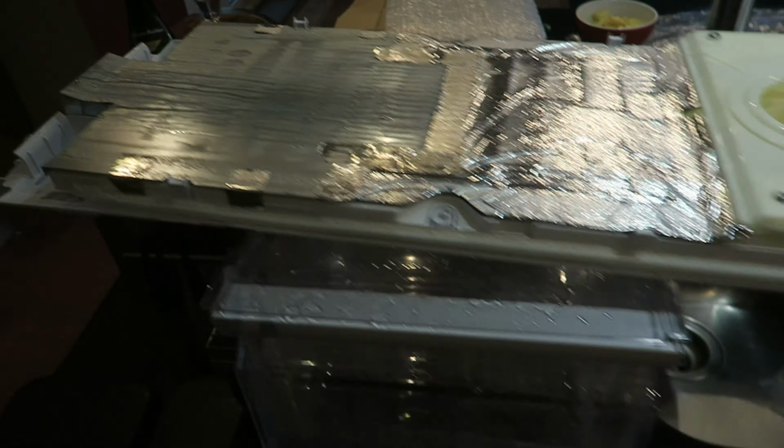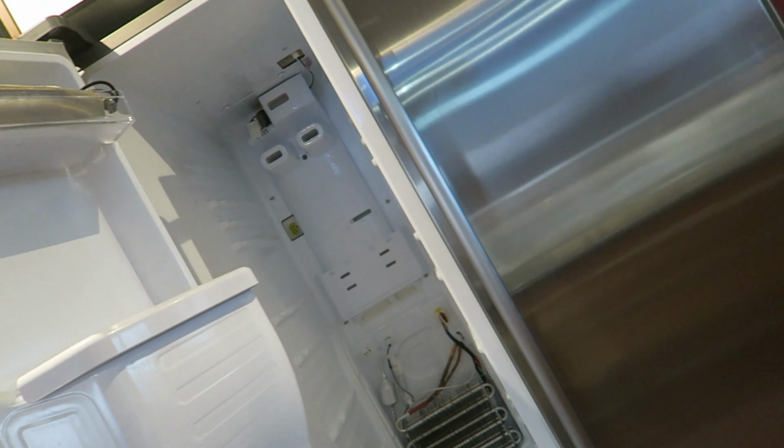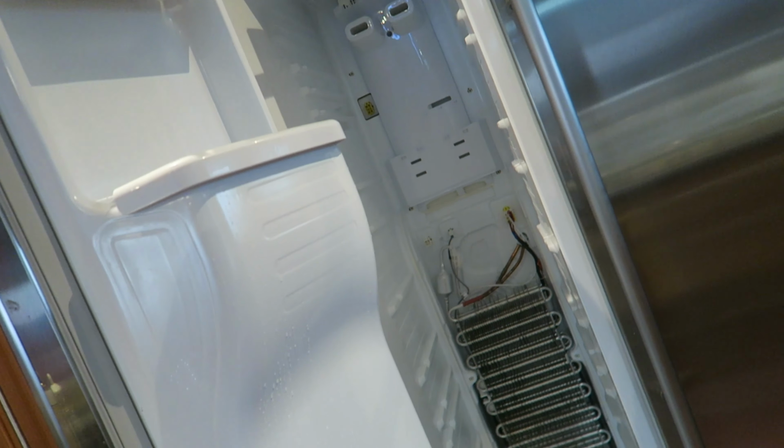So this is all the bits for the fridge, the fan unit, those recirculates, the ice making machine, part of it, and there is another bit there of the ice making machine. So let's put it all back together and I'll show you. So this unit is very similar to the other one. You have one screw there, another one there, and just clips down the bottom. And then you have one plug there to be plugged inside the fridge. There, okay. Let me put it back together.